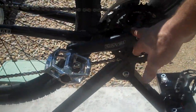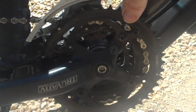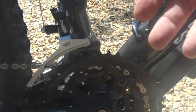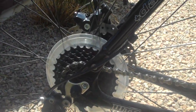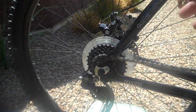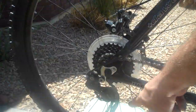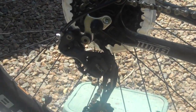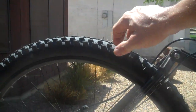Down back to the three-piece cranks and the three-sprocket front gear. The front derailleur was way out of adjustment, but BikesDirect sends you YouTube links showing how to adjust the front and rear derailleur. With that it took me probably about an hour to flip my tire, set up the derailleur, and adjust my calipers — and this bike's been a dream ever since. It's got the Shimano rear derailleur. It works pretty decent, a little sloppy. Sometimes it catches between two sprockets and jumps, which makes for sloppy gear changes.